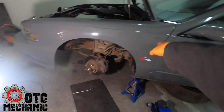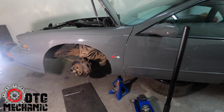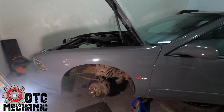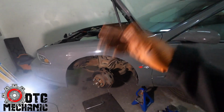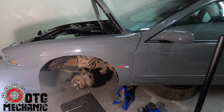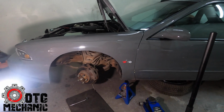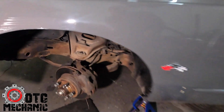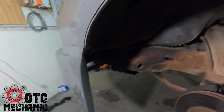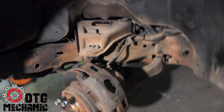And then I'm gonna paint the frame, make it look all nice with the new suspension and all that good stuff. Paint the coil and all that. So tonight's project is getting the front end torn down. So getting everything off, so we can paint all the spindles, all that stuff, taken apart, so that we can paint the frame, paint the sway bar, paint the coils, and it doesn't have to be super nice, just better than it looks now. So looks like somebody already attacked under here, but we'll add a little bit more. I got some undercoating I can put in there, and I'll clean this up with the die grinder and paint it back black with some undercoating.